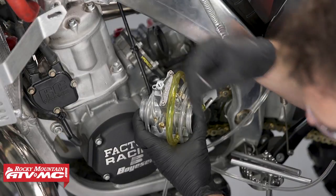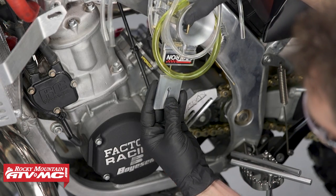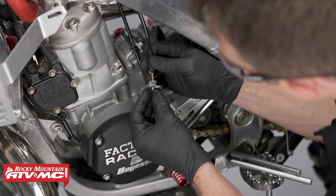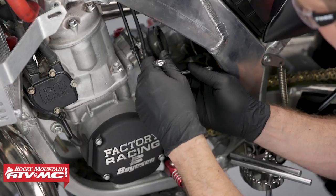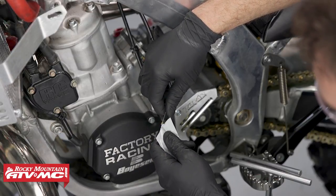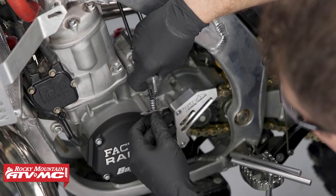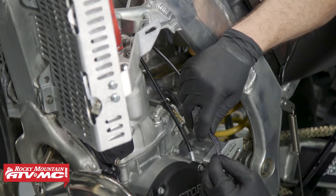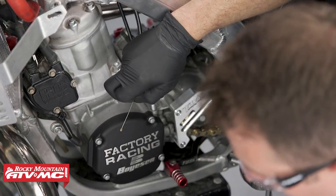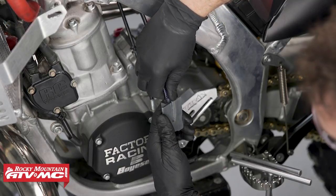Now back on the other side of the bike, we'll take these three screws out of the top of our Lectron carburetor, and then tip it upside down and remove the slide. We'll set the carburetor aside for a second. Now we'll take the top of this carburetor and the end of the cable and screw it into place and tighten it up. We'll slide the boot right into place to keep everything covered. We'll take the cable and put just a little bit of white grease on that end. Then we'll take this spring and gasket, put these into place, and feed the cable through them. Once the cable is through, we'll pull the spring all the way back, take our slide, and install the cable through the circle at the bottom and then straight up through it, letting the spring come all the way down.